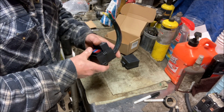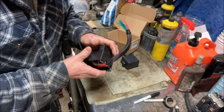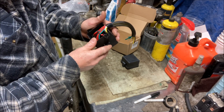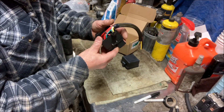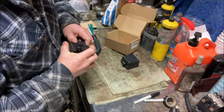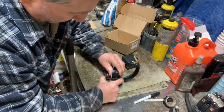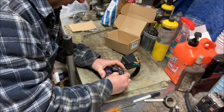The first thing I have to do is figure out what's what in this bundle, because as usual when you buy something like this, they don't tell you what anything is. Looking at the back where the wires go into the relays, I can figure out which color is what. These are just four-pin relays — not using 87A because it's not needed.